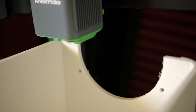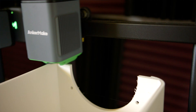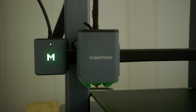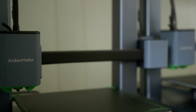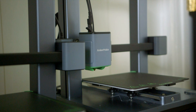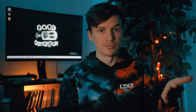3D printing a speaker allows us to do a few things we wouldn't normally be able to do, but a lot of people were concerned about using a 3D printed speaker because they worried it would resonate. The nice thing is it's all about rigidity of the materials you're using — the wall thickness, the infill dimensions. You have pretty firm control over what the cabinet's going to be like and how rigid it is. That's why it's very important, when we get to the print settings section, that you pay attention to the settings I used. If you don't print it properly, you can get a speaker with a messed-up frequency response or resonance issues. But if you print it correctly, you shouldn't have any of those problems.